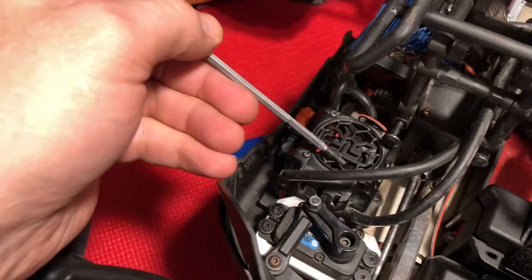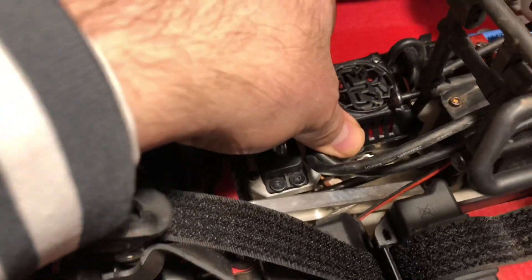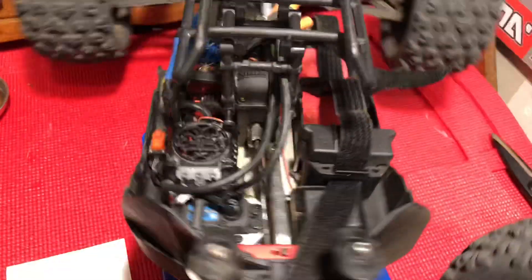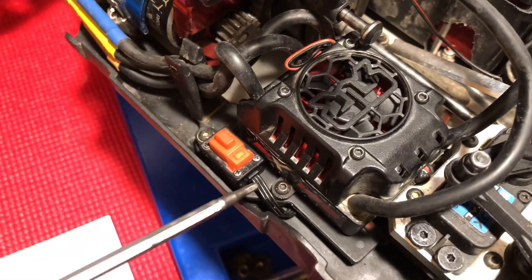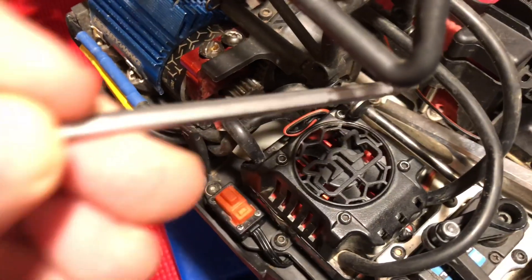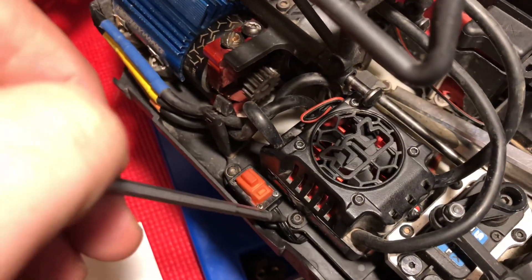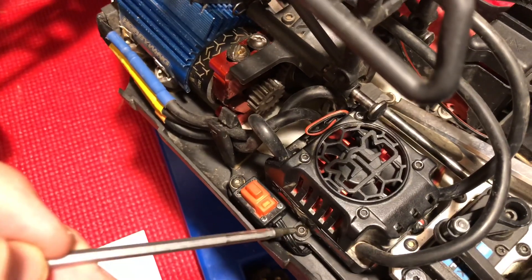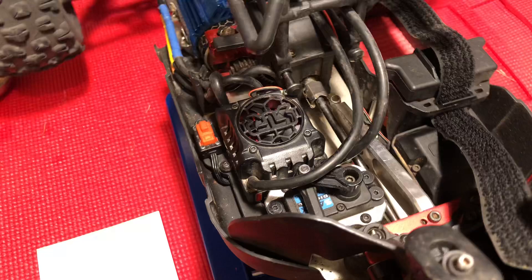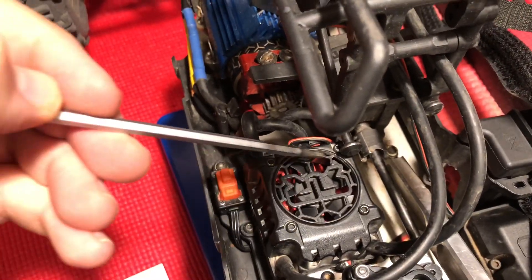When I came in to start looking at what was going on, I thought at first there might be something stuck inside — a little piece of debris. But when I went to feel the whole ESC, it was loose — I was able to wiggle it quite a bit. The ESC is mounted in only two spots, one on each side, and the mount on one side broke completely, so the whole ESC was loose and it off-kiltered the fan's positioning, which is why it was getting snagged.